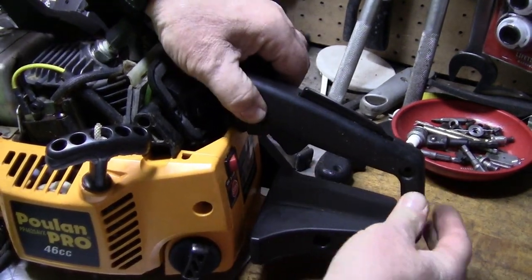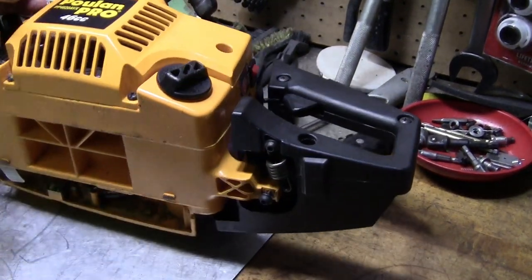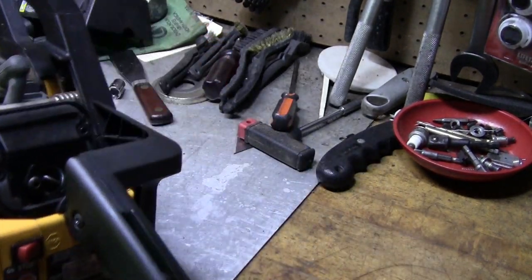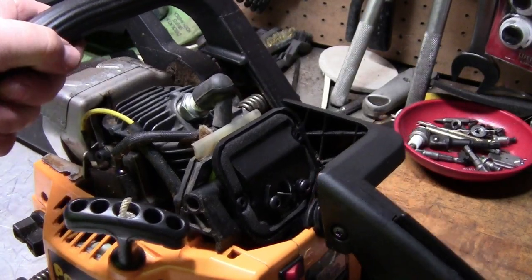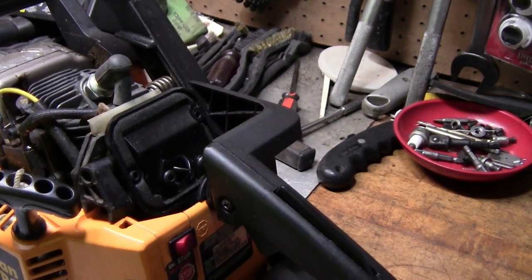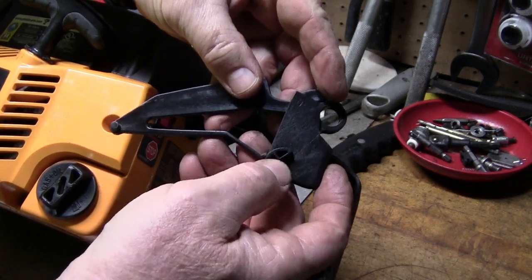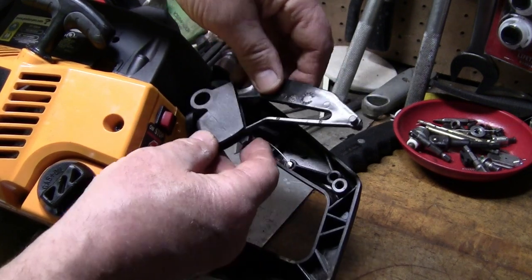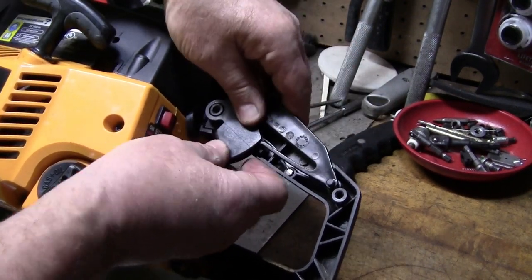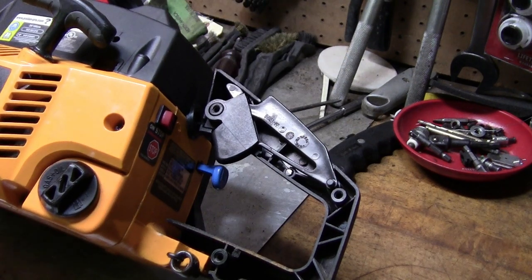Once you've got the cover on, before you put your screws in, go ahead and test it to make sure it works. Now go ahead and turn it over, take that bolt out, and put your spring on there. Make sure your choke works. Go ahead and check your throttle and safety. Put your filter back on, then go ahead and put the cover back on it. Now when you're hooking your throttle handle back up, see this little indention right here — the throttle cable has got to go over top of that when you put it in there, or else your throttle will not work. There — your throttle works. Now go ahead and put it back together.